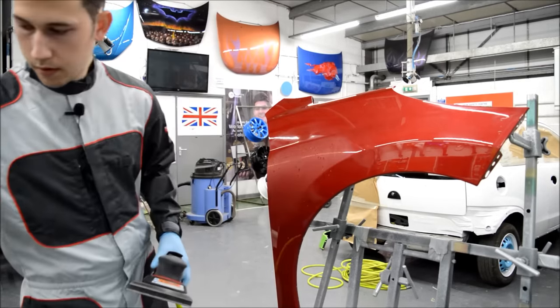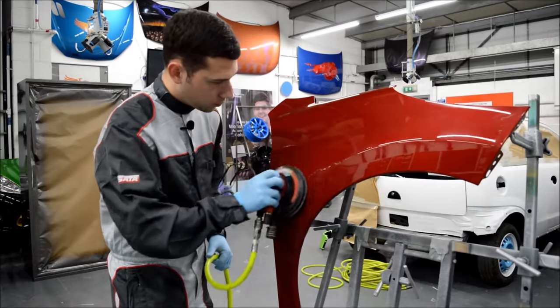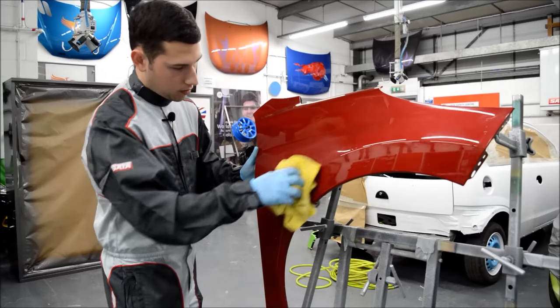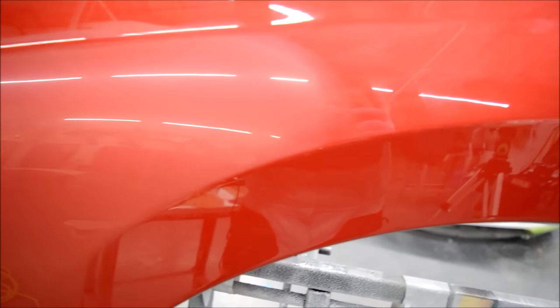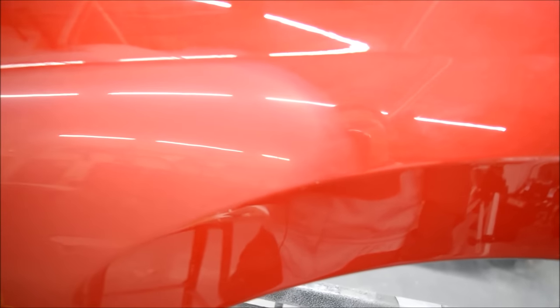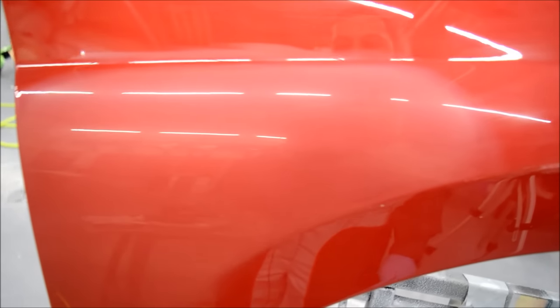Again, clean water. We're just going to wipe down our panel with our microfiber and get a close-up. That is the 6000 Trizac disc result — as you can see it's nearly shiny, and it actually looks better in person than on camera. It won't take much to polish that up at all. This is where it's beneficial: it's cutting the polishing time down, and having the 6000 helps reduce flattening marks appearing in our paint jobs when we eventually come to polish them up.